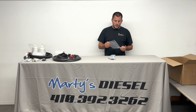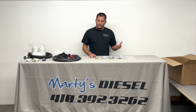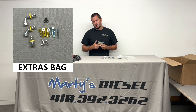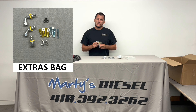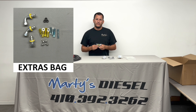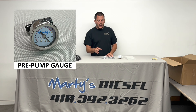On a traditional old body style electronic fuel conversion kit from our company, you get a bag that has four bags inside of it. You get a whole other bag of extras — every electrical connector used in the kit has an extra. You've got stainless steel self-tappers to hold the relay and resettable circuit breaker onto your firewall, extra dash-six fittings, and the little black dash-four vibralock connectors for the back of the factory fuel rails that go in the back of the heads. If you want to change those out, they're included in your extras bag.